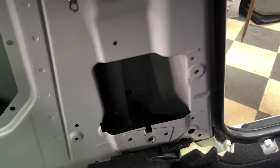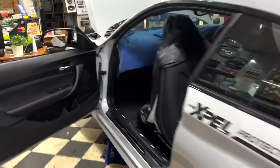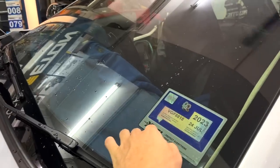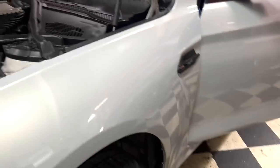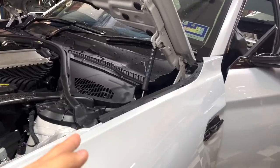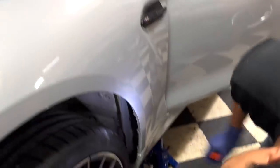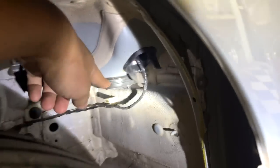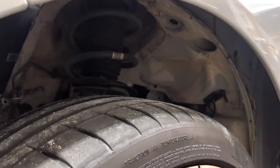It's all about getting the chassis rigid while keeping the suspension compliant. But the stiffer the suspension, the more rigid the chassis needs to be, and then you get less vibration. Before they start, I'll show you something interesting from their experience — the water test. They throw some water to find out how it flows. This is important because if you foam against where the water is flowing, you're going to start accumulating water in the car. So you can't foam that part.